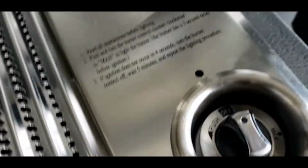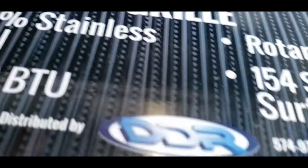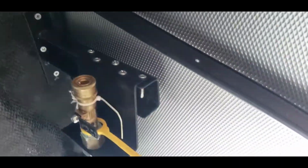Outdoor grill. To light this, you just turn this, and you can hear the clicker. It clicks. And you just keep doing that till it's lit. However, you still have to pull this out. Grab this. You've got to grab this propane line that's back here. It should be. Yep, right behind here. You can look up underneath here. There is a propane quick disconnect right there, and then you turn that black handle to open the valve, and then you can light the grill.